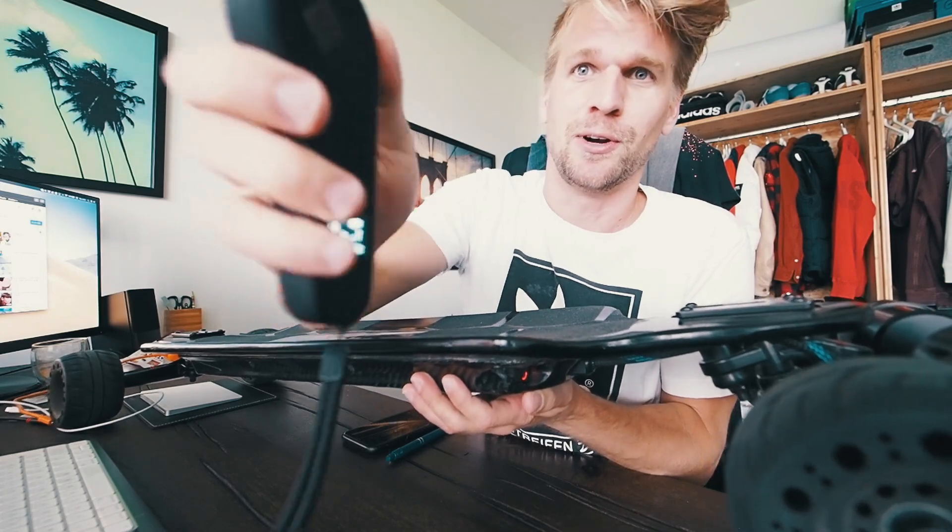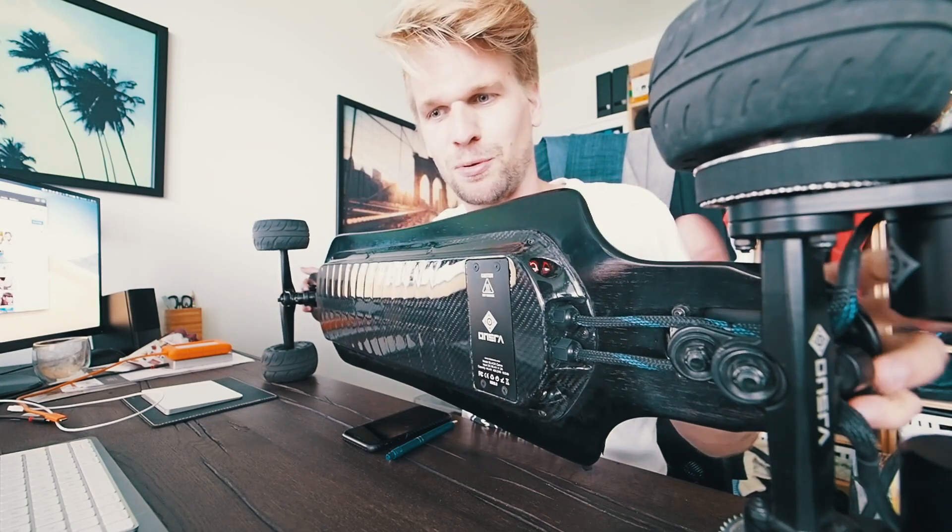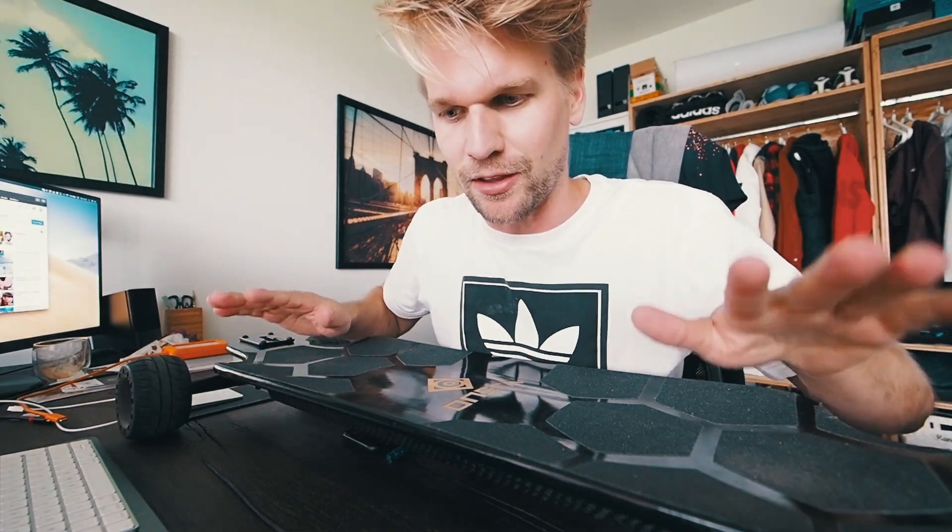It's connected — all good. Let's see how fast it is now: 55 kilometers an hour. But this board right here has different pulleys — it has 54t pulleys. So if you have 40t pulleys, it will be a lot faster. Definitely wanted to add that: you don't really need to change anything on the remote controller if you change to 40t, just leave it at 3.2. This setting is actually for 40t pulleys.